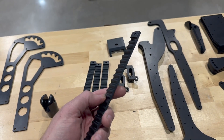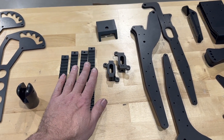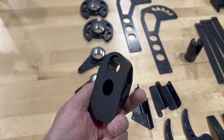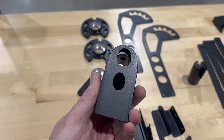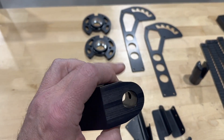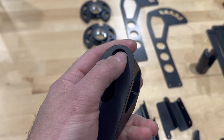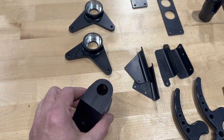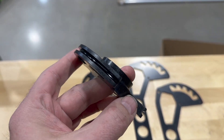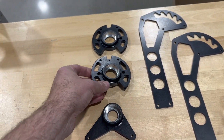The seat tracks have aluminum grooves that are going to receive some abrasion, so a type 3 hard coat anodize is very useful there. I also did a hard coat anodize on the tailwheel block — I disassembled it and took all the mechanism out. I went with type 3 hard coat with PTFE Teflon coating for really good abrasion resistance in the bore where the locking mechanism will be riding. I also did type 3 hard coat PTFE on the aileron bell cranks, where stainless steel cables ride in grooves — I just didn't like the idea of stainless steel cables on raw 6061 aluminum.